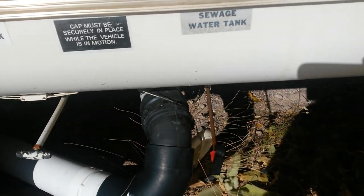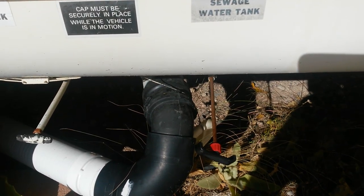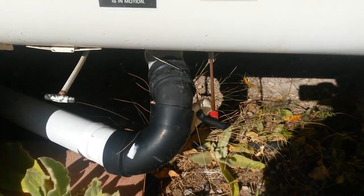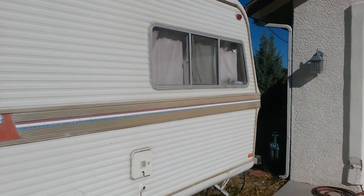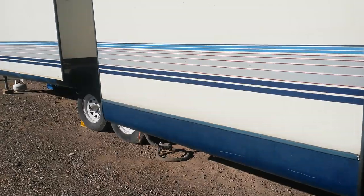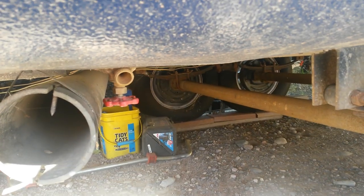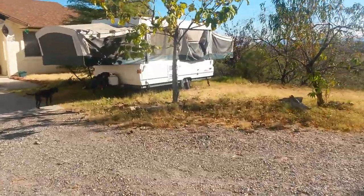So drain your tanks and flush your black water tank. After flushing, push the valve in and out a couple times to loosen up any debris, and then once you're done, push it in and out once just to make sure it's free of debris. The second thing you want to do is find your fresh water tank drain valve and open that up to start your fresh water tank draining. This older model has a tank under the bed so I have to go inside to open that valve. On newer ones you'll just have a standard spigot that goes straight to your fresh water tank — just open that valve all the way and let it drain completely. I usually let it sit for about an hour.